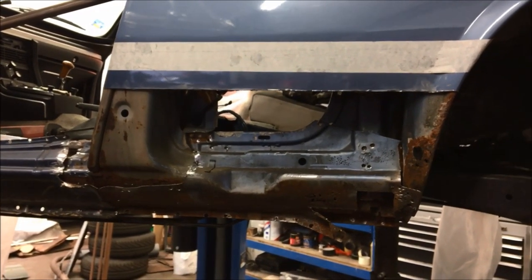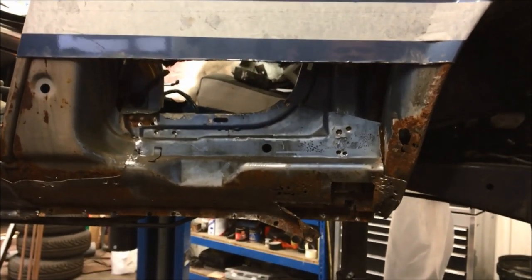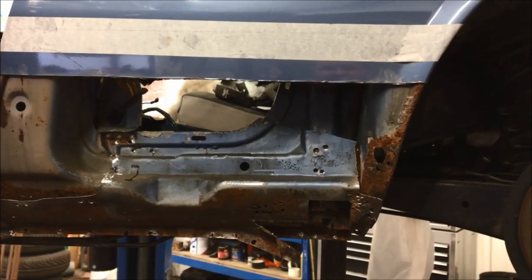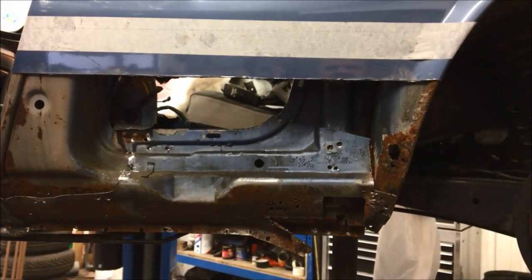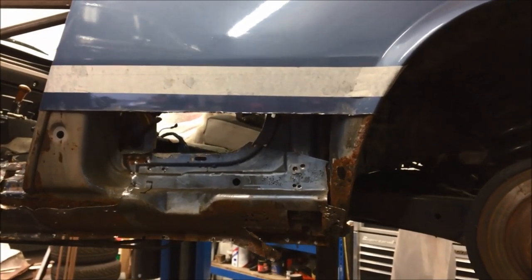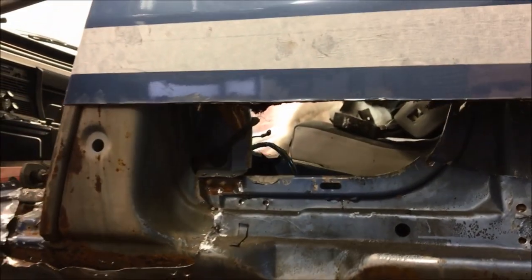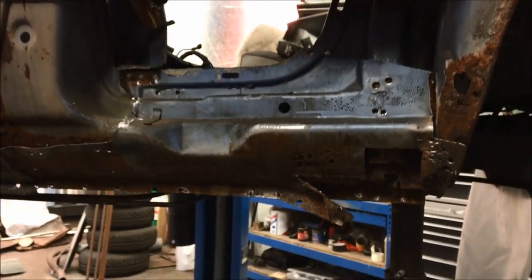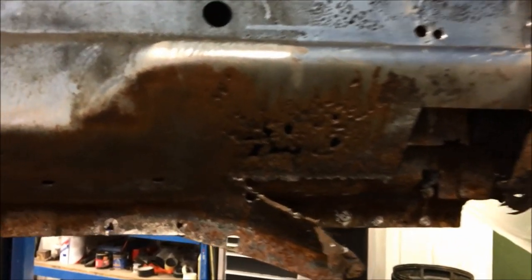This is an Italian 3L CSI that we're opening up now. I showed you the other side of the car where there's a small amount of corrosion just starting on the forward section of the rear wheel arches. What we always stress to people with an E9 is: if you see corrosion on the outside, without a doubt there's going to be more serious corrosion on the inside. We've taken off the lower section of the rear quarter to expose the outer sill, and we'll drill out all the spot welds to remove it.